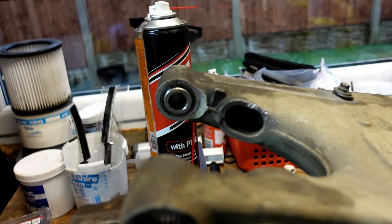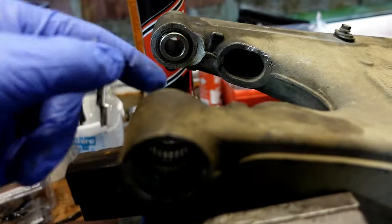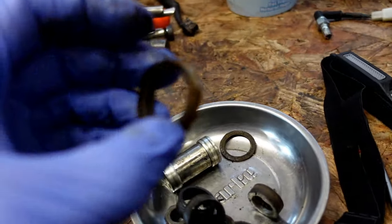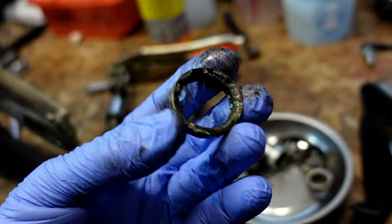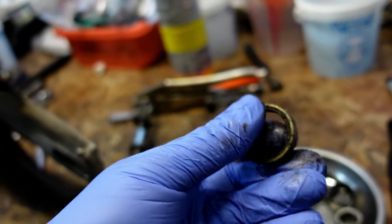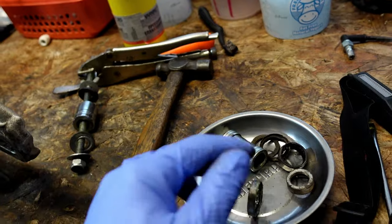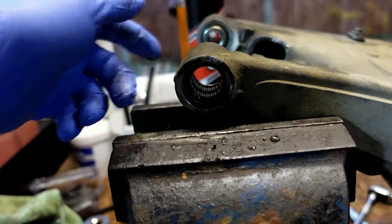I don't use a pressure washer on this thing, especially in places like that and on the back wheels and things like that. So I don't know. But yeah, they're in a sorry state. They're absolutely bogging. That's this side seal, and as you can see, it's still got grease inside it, which is good. So pull these two bearings out, and then get them replaced.